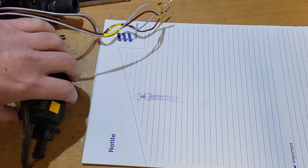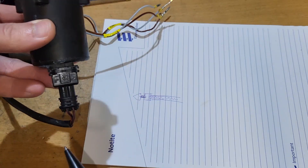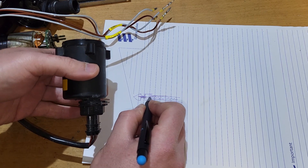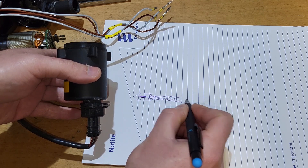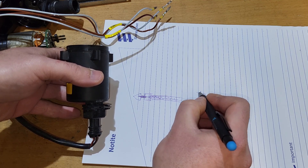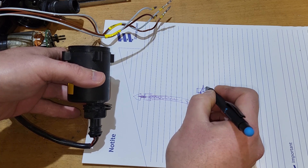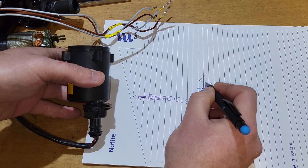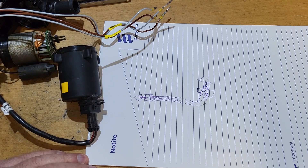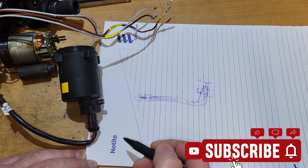When the water started escaping behind the connector, it went inside these terminals, inside these seals, and through the copper wires it traveled into the ECU. The same principle applies at the ECU end: here is the seal, inside is the insulation, here is the copper wire, and here is the terminal connected directly to the copper.